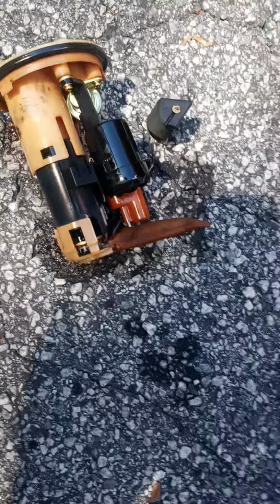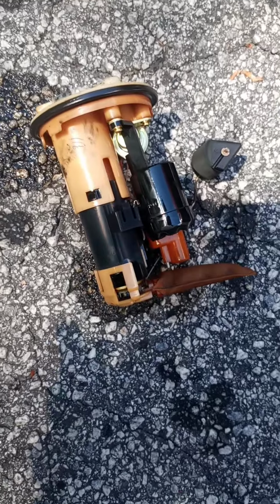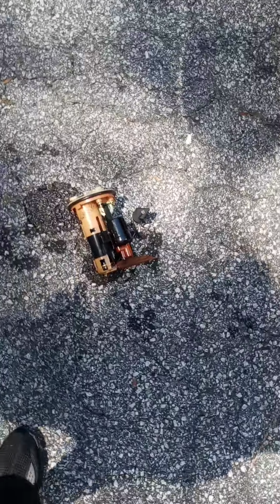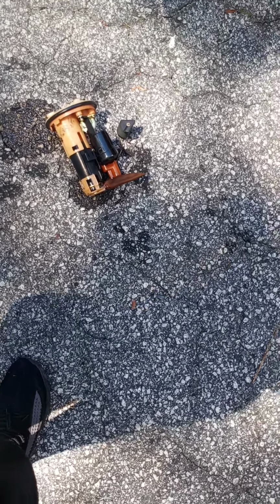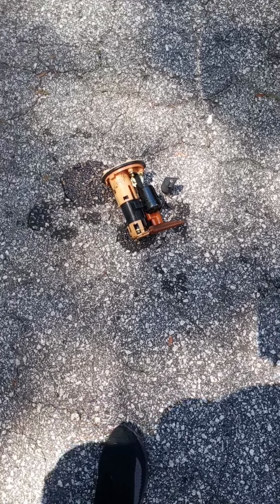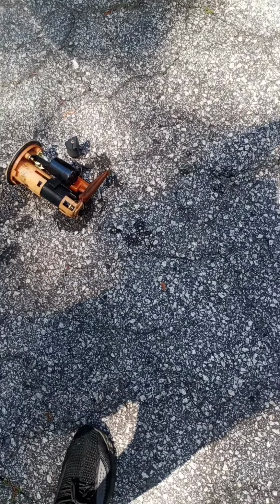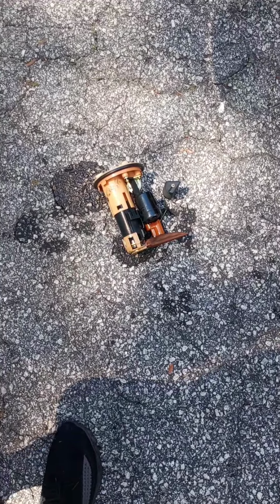Back seat. When you get ready to crank the car, don't just go and crank the car and expect for it to crank. I always purge my fuel pumps. And what I mean by purge is I cut the key on, listen to the fuel pump burp the fuel and the air out of the system for about 5 to 8 times. And that way I know that it's got fuel from the motor and the fuel pump up to the fuel rail system, and I should have no problem whatsoever cranking the car up after I'm done.